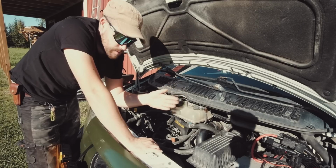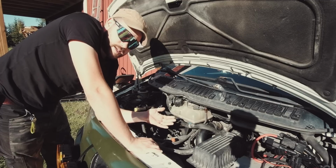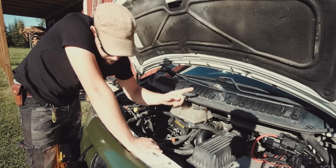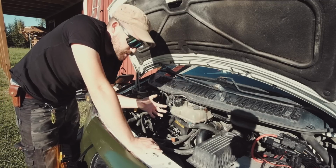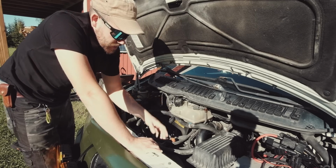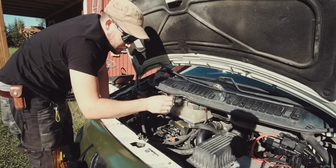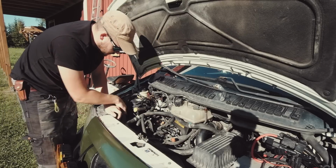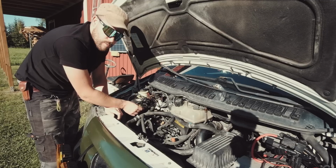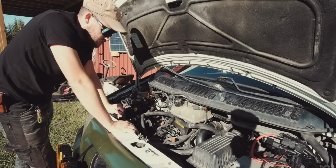So I assumed it was this one, started the engine, and that one got hot first. So my question is, is that the correct one to tee this into? I assume the flow is going that way. That pipe got hot first, obviously that's coming from the engine into the heater and then back out. So from the pipe coming up, this tube then went to the bottom of the unit into the pump, and then the outfeed of the unit, which is the top, goes back. I just assumed that's how it went.